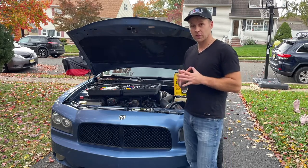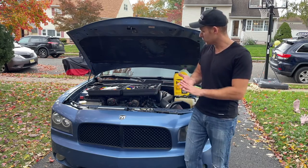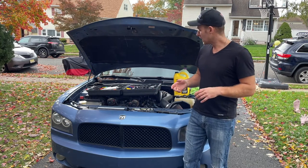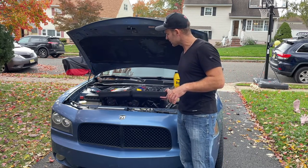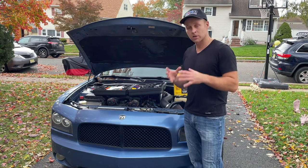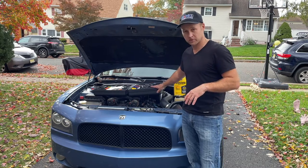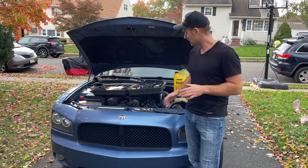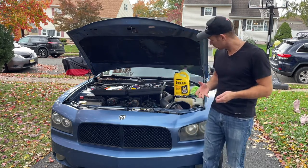So now I'm trying to figure out what it is. I want to pressure test my cooling system first before I start blaming the thermostat or the water pump and stuff like that. I got this kit right here from AutoZone — it's a cooling system pressure test kit. It's universal, meaning it has all the adapters to test it on most cars. You can rent tools from AutoZone for free. I did have to pay $260 upfront and I'll get my money back when I return it, but I've seen these kits on Amazon for under $100. So let me show you guys what we're going to do.